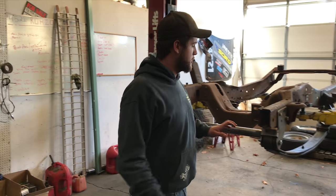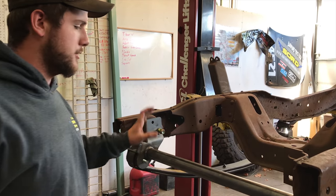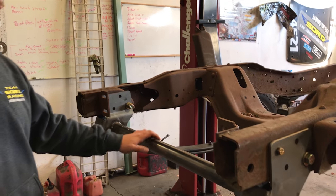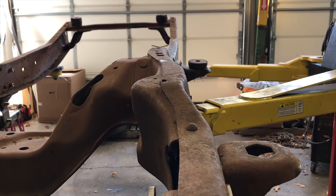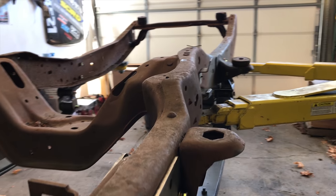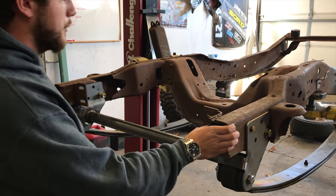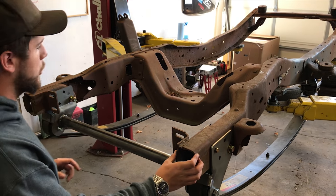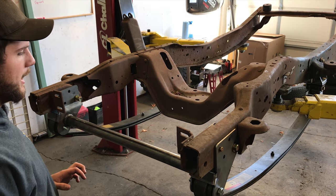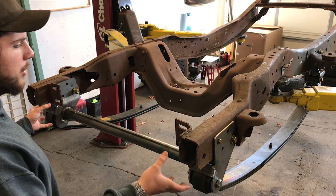First I'm going to talk about some of the areas we've seen these frames fail. For starters, not having this cross bar up here — your steering box is huge — so when your truck is trying to steer and you're not moving, say in a parking lot, this frame section is actually twisting quite a bit. That will lead to a common failure in your cradle and these rivets breaking out. We've seen multiple trucks like that and I attribute that directly to not having something really solid holding this together.